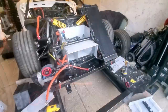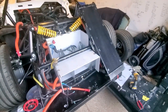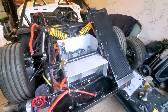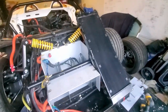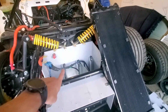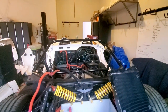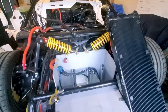Okay, all the battery modules are out, the entire car, front and back. Got all these cooling plates cleaned up. I've got to clean up the battery modules, then apply the thermal pads and put things back in. The thermal pads I think are due tomorrow, so I'm wondering if I should look at replacing coolant lines. These are the old ones, the yellow, and I replaced the back with the blue, which is way better than the abraded ones. I'll look at that, though it might be more than I want to do.